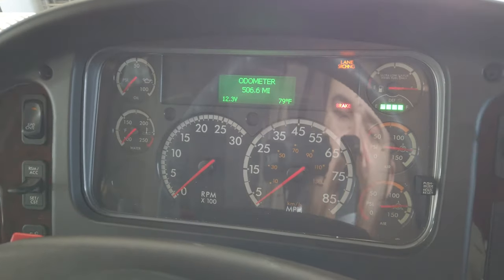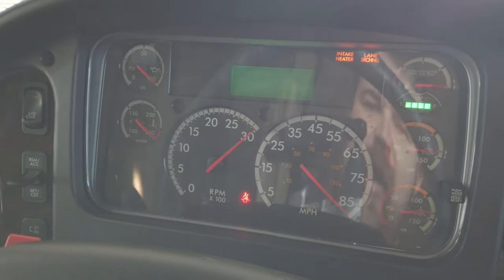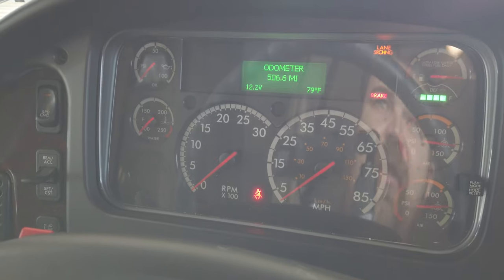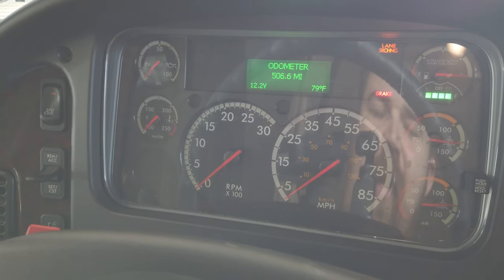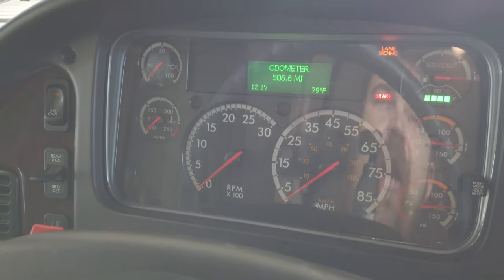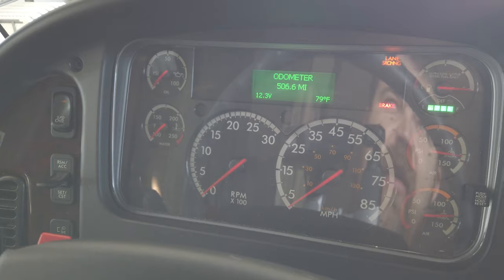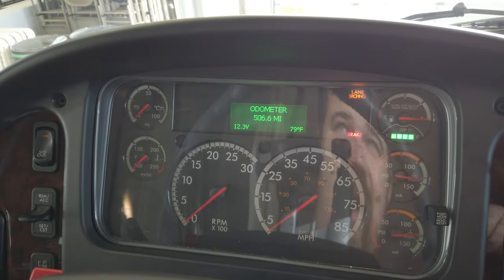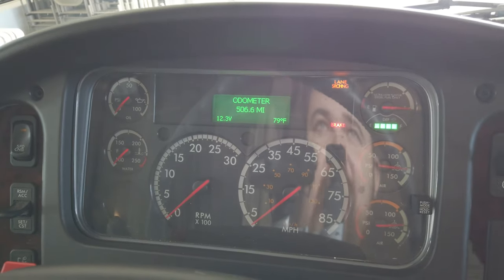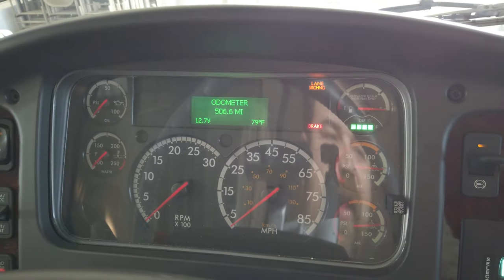What's important to know is fault code severity. If a yellow light comes on, don't pull over immediately — drive. Do you feel a difference? Hear something? When you get a chance to pull over safely, make sure you don't see anything dripping. That's basically just telling you a minor fault code was read. Fault codes have key cycles associated to them, so if you key cycle the engine three times for a particular fault code, it may clear itself. You'd only waste your money going to a dealership to chase down something that no longer exists. The red stop engine light is only associated with catastrophic engine failure — in that situation, get off the road as safely and as soon as possible.